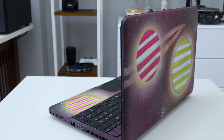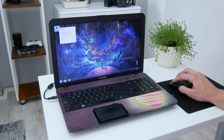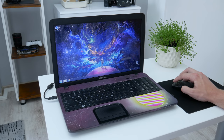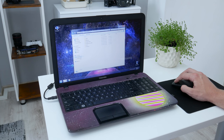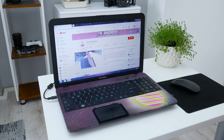After all is finished, let's move on to Windows. Because I wanted to do some performance tests, I tried both Windows 10 and Windows 7. Windows 10 on this laptop works pretty good, but compared with Windows 7, Windows 10 is much slower. So I've decided to stay with Windows 7. The boot time with Windows 7 is about 7 to 9 seconds, which is pretty good. With Windows 10, the boot time is about 15 to 18 seconds, and the software, web browsing, and everything else is a little bit slower. But basically this laptop is good for all daily tasks — working with documents, listening to music, web browsing, using social media, watching movies and videos.